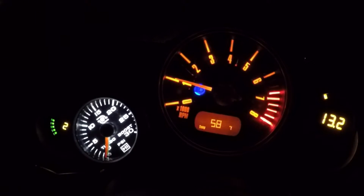I'm going to pull out, get into second gear at about 2,000 RPMs and hit it. At 2,000 RPMs, the supercharger is going to provide about five pounds of boost during spool. We're going to see the green needle — the supercharger — move up as RPMs increase. Then as the red needle comes up, we'll see the gap between the red and green needles stay about the same, or actually get a little bigger.